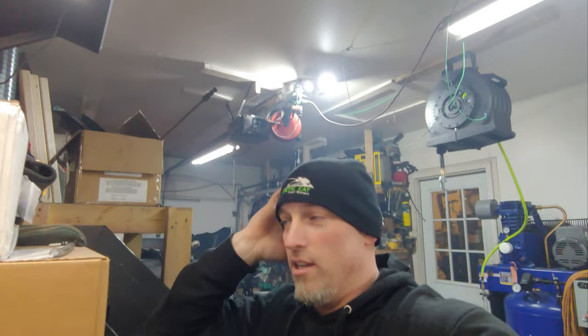You can see when I'm sitting at the line, I was trying to get the clutch partially engaged, to the point where when you launch there's no lag time between your clutch engaging and your wheel starting to spin. So you partially engage it to where the chain's tight, and then boom, you just let it go, twist it and launch. Well, you can see it kept catching and jerking me forward.